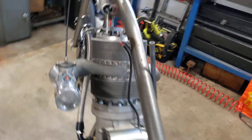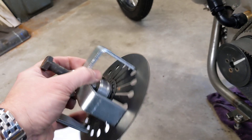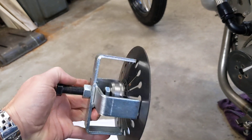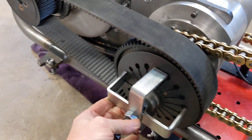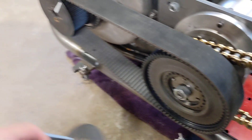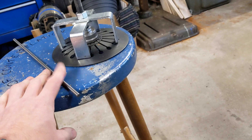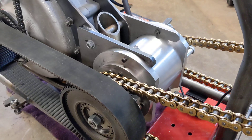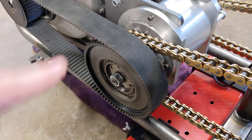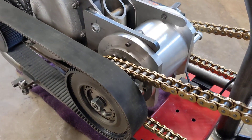Right now I'm fitting the spring diaphragm on this side of the clutch. This is a special tool that comes with the spring diaphragm from Fair Spares in Norton — you use it to apply pressure so that when it goes into the clutch basket you can fit the circlip around the outside, then release the tension and fit the center part to adjust the clutch position. Don't forget to include the silver steel bar that disengages the clutch.